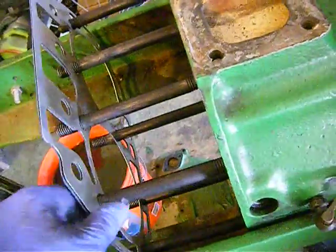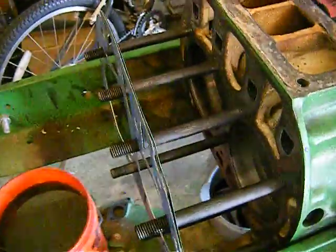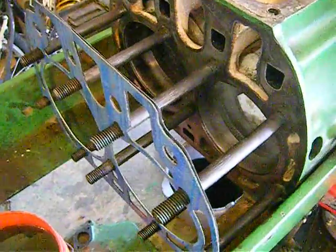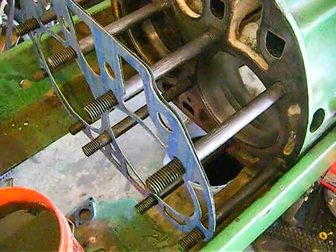I've got a new gasket. The book does not say which way the gasket goes on, so I'm putting the fiber side towards the head and the metal side towards the block, because there are absolutely no directions on it. I can't find any — can't find them on the internet either. One person says this, the other person says that.